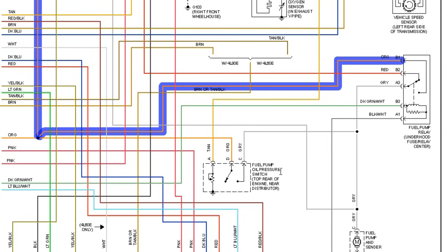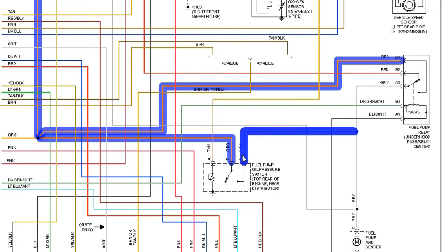Let's take a minute and review this wiring schematic one more time before we move ahead too much further. As you can see, this is the fuel pump oil pressure switch. It shares the same power source as the fuel pump relay that goes up to that main fuse, which we know is good because we checked that in the previous video. So if everything were working correctly, it would switch over and go to this gray conductor, which would go straight down to the fuel pump and allow it to run as long as there is oil pressure, even if the fuel pump relay fails.